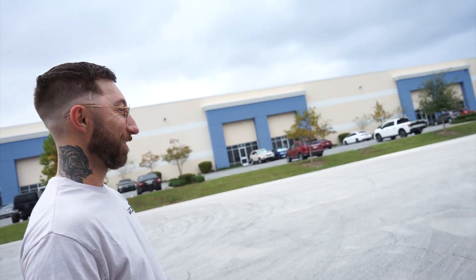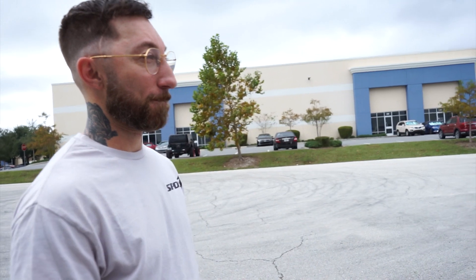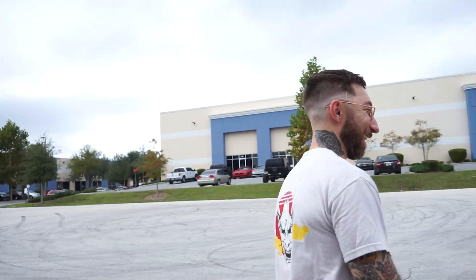How's the translation from the road to you as the driver with the thicker side profiles? It's amazing. It's definitely a lot more confidence going into cornering, which is huge. My SC has thinner sidewalls and the smallest bumps are like, boom — you feel everything. The setup I had before was a 16x9 on a 195-40 tire, so my lip was a little bit out. As soon as I would take a corner on like exit ramps, it was only a matter of time before that rim started touching the ground. That's so sketchy — that's when I was like, okay, I'm done.